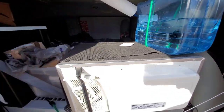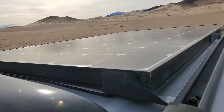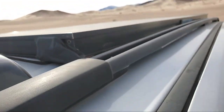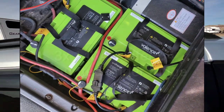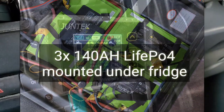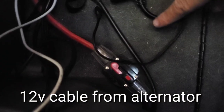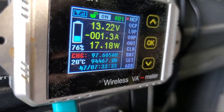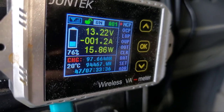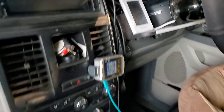Here's the solar panel — it's a windshield-style solar panel fixed with basic hardware from Home Depot, super simple, attached to the roof rails. It's a 327-watt panel feeding 400 amp-hours of lithium batteries sitting below the fridge next to the diesel heater. I can also charge the lithium batteries via the alternator using my breaker as a switch, as long as I keep the voltage under 13.8 volts.